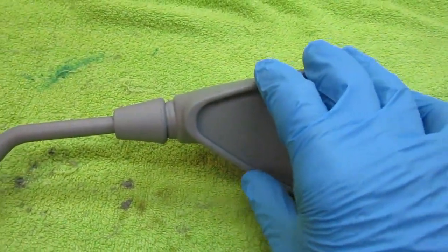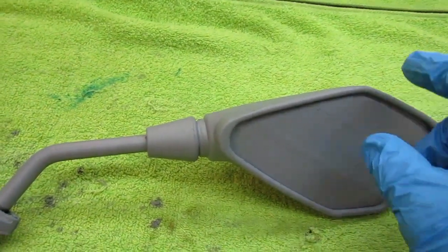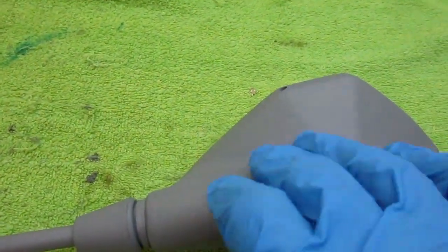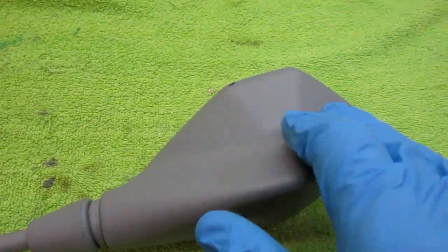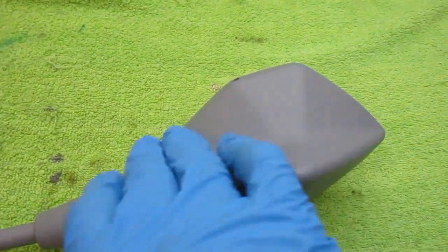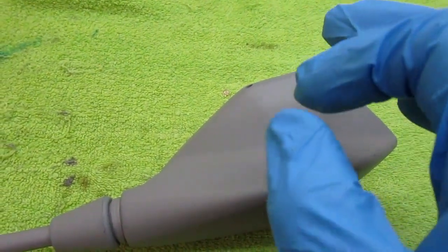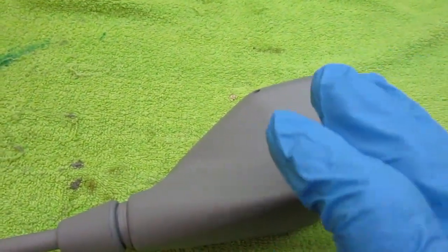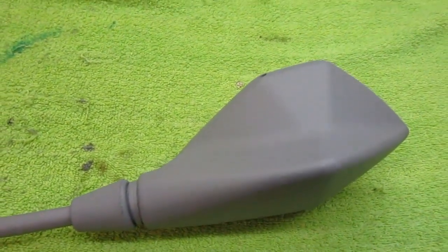Now these same tips would apply to any motorcycle or anything you paint, really. Because this is plastic, we've used primer sealer — not primer. Of course, if this were metal, we'd use self-etching primer. I used that little sanding tool we got from Harbor Freight and that seemed to work great. A lot of people would paint right over this and that would be fine, but I always want to go that extra little step. I always like to say: which part do you want on your motorcycle or in your living room? By putting maybe an hour of sanding into these four mirrors, it's going to make the final product that much nicer.